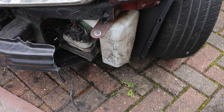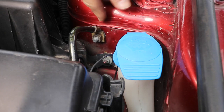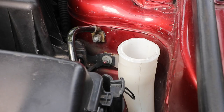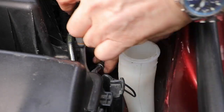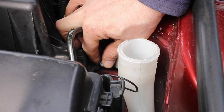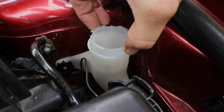Now we've moved the bumper out of the way we can clearly see the retaining nut at the front. Now back to the water bottle - we need to take off this top nut. The blue top cover just simply pulls off from one side and all the retaining nuts are 10mm. Take out the filter - it simply slips out.